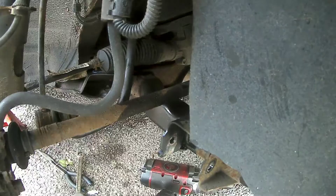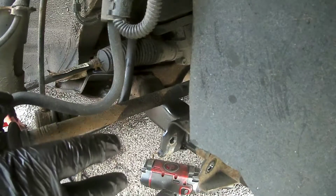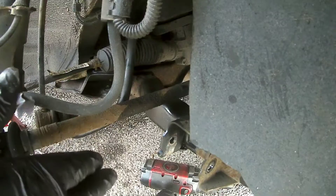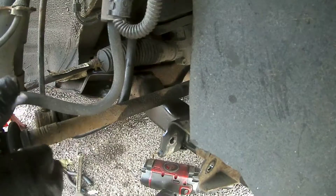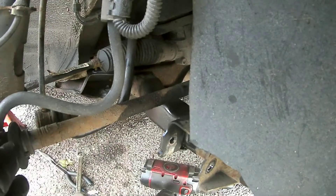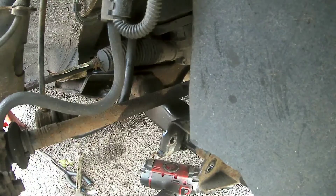Now off camera I just checked that the parts are exactly the same. I'm going to clean up these mating surfaces and then put it back in reverse order. Apart from one slight difference — I'm not going to bolt it up until I've lifted the hub up so it's at road height, so these bushes don't rip later on. You just get them seated where they would be on the normal road and then tighten them up. Thank you for watching — if you enjoyed the video please hit the like button.